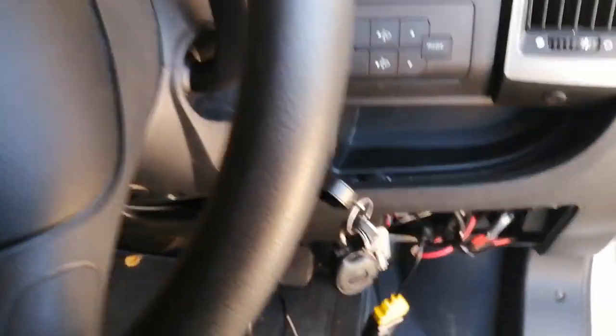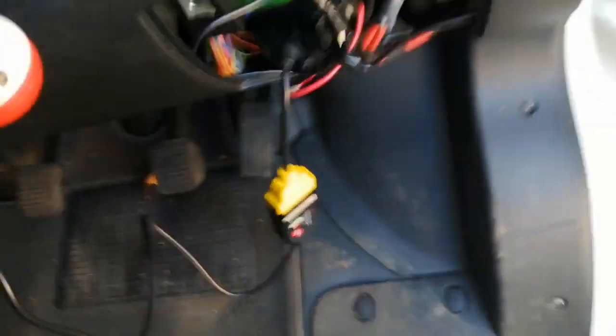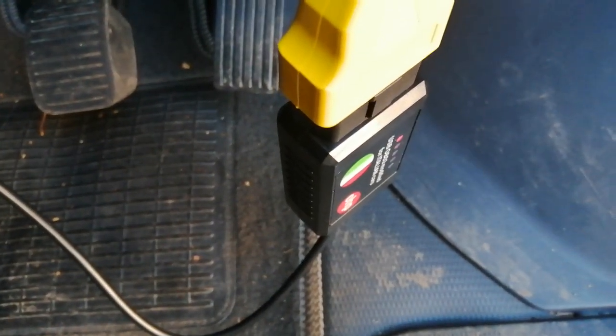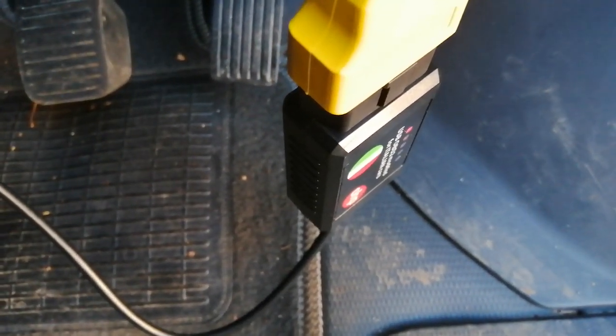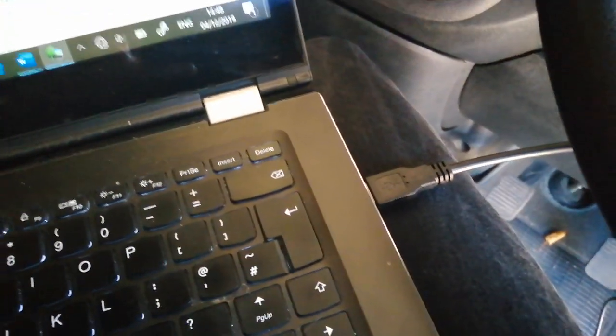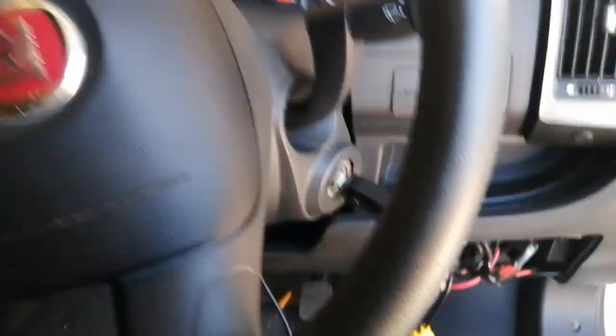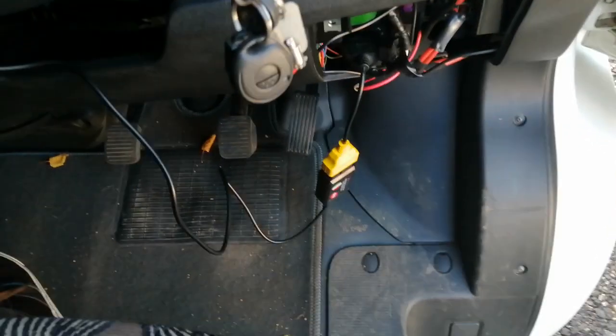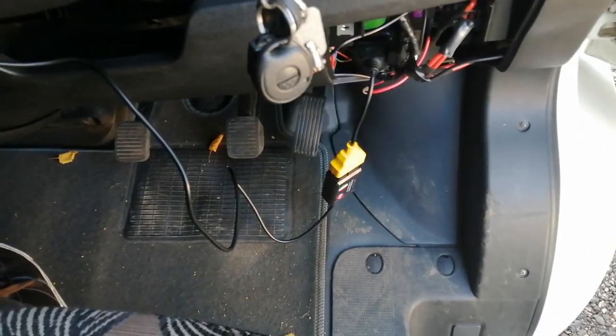What I've also purchased is a yellow adapter cable down here, and that's plugged into the vehicle OBD2 port, along with a diagnostics interface called an ELM327 interface cable that plugs into the laptop via USB port. So you need those three things for the airbag at least: the yellow cable, the ELM327 diagnostics cable, and the software.